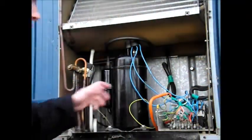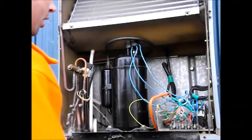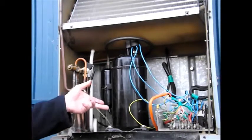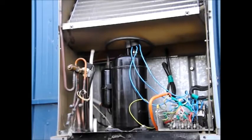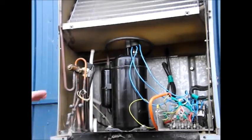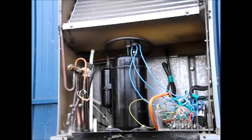I've rewired it. The spade terminals were shitty. It's a bit chicken and egg — it's sort of impossible to work out whether the spade terminals are cooked because the compressor's got something wrong with it, or... I think that's actually the case. They were kind of corroded underneath. I thought the tape could have had something to do with that too, but I think they've just been hot.